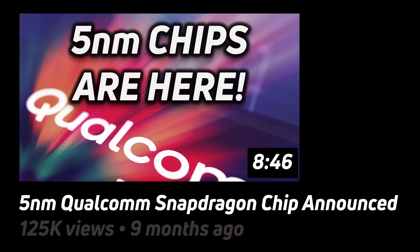I've got a whole video on this channel about the X1. The X1 is designed to really increase single-threaded core performance. Having one CPU that is bigger and more powerful will use more energy, however it can get the work done. Backing it up are three Cortex-A78 cores and then four Cortex-A55 cores. So that should give us good single core performance and continuing that uplift in the multi-threaded score. The whole processor is built on five nanometers, as I predicted back in February, because Qualcomm announced the X60 5G modem which is integrated into the Snapdragon 888 and they said it would be a five nanometer part.